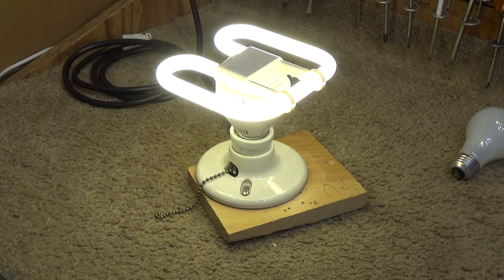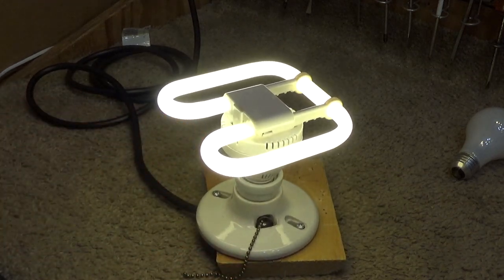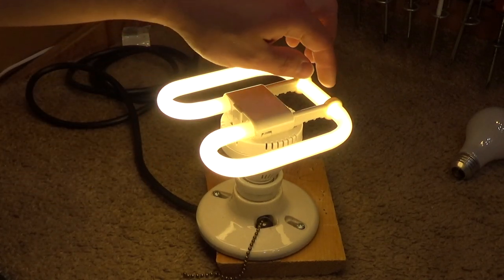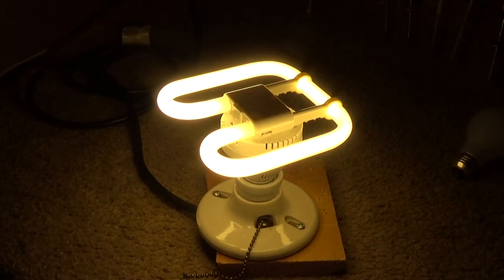It's not quite preheat, but I did see a little bit of flicker there before it started up, so it's definitely not that ridiculous rapid instant start — which just burns through the tubes in no time. I can see in person it's very bright here and here, and then dimmer on the outside, so it's taking its time to get going, which is fine — that means the bulb will last longer. Very nice color; it looks exactly like an incandescent bulb at 2700K.